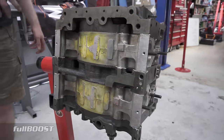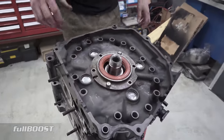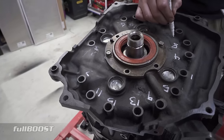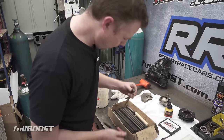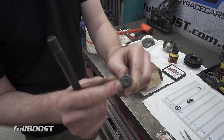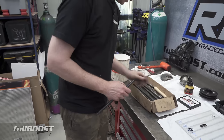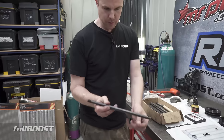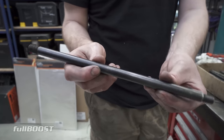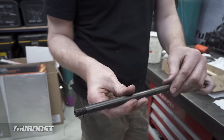Next step is to put all these through bolts through — as you can see, we machined all these holes. I'll number all these for the torque sequence. The through bolts tie this big sandwich together. We've got the M-bolt — there's the Mazda logo M stamped on it. These longer ones are found in all rotary engines on the outside, and we'll use two of these M-bolts. The rest of the bolts will actually be studs — these are PowerSeal half-inch studs. They utilize a factory M10 by 1.0 thread up at the front plate, but they're a much bigger half-inch unit here with a UNF thread — half-inch UNF.